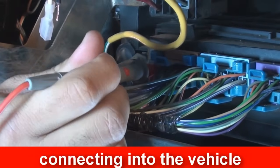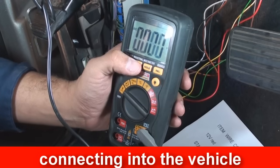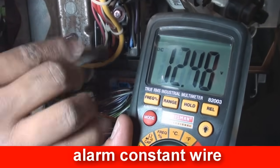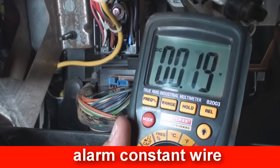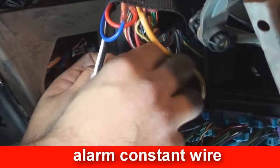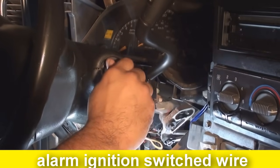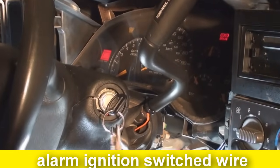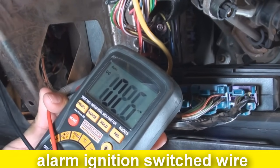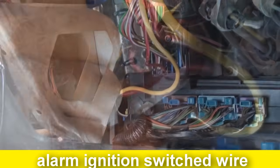Let's locate, test, and integrate the circuits for our alarm. Bring out your tech notes, multimeter, and connectors. We will start at the top of the tech sheet and make our way down. The 12 volt constant wire connects into the vehicle circuit that shows 12 volts regardless of vehicle key position, even when no key is inserted — it is normally found at the ignition harness. Use your test lead to verify the circuit, then once verified, integrate into the circuit. The ignition wire connects into the vehicle circuit that shows 12 volts when the key cylinder is in the on position, which is the second click over, and also shows 12 volts during cranking. This wire is normally found at the ignition harness. Use your test lead to identify the circuit, then once verified, integrate into the circuit.